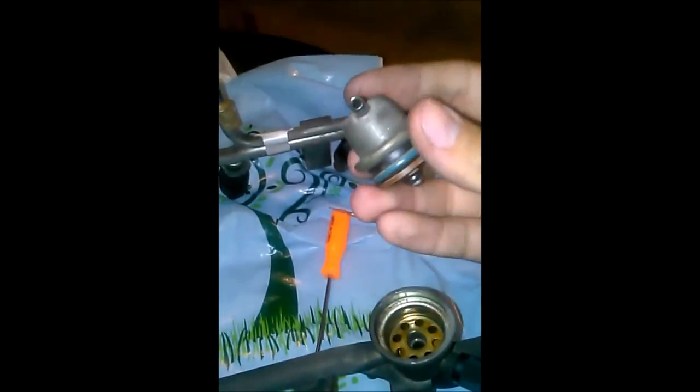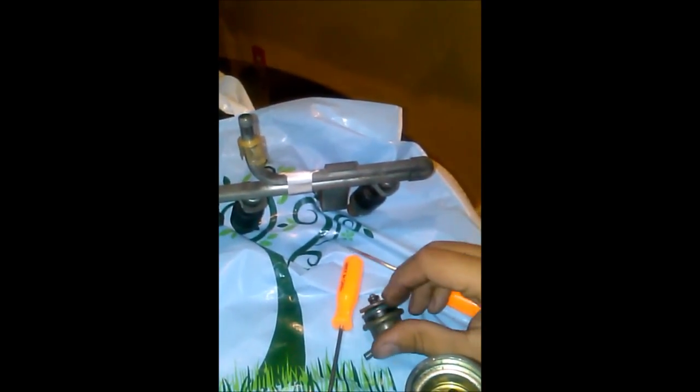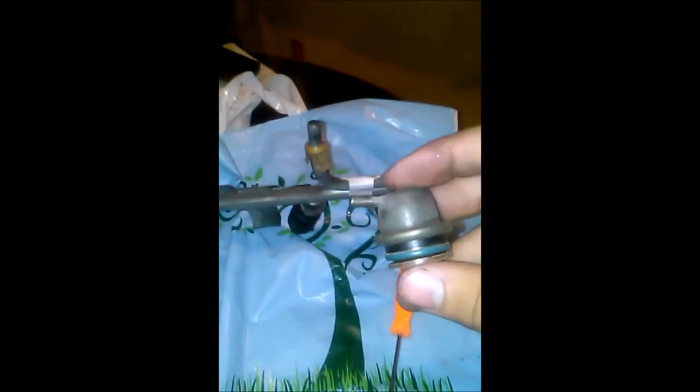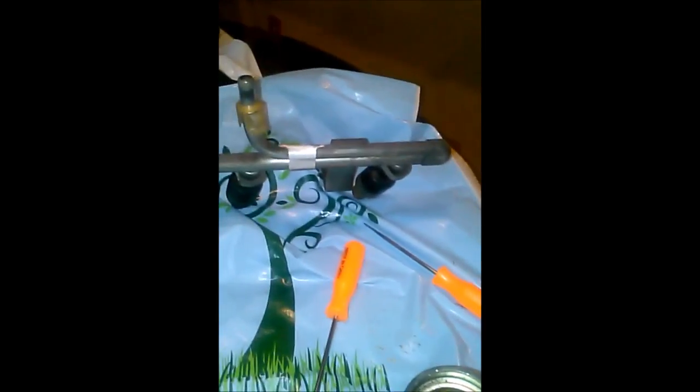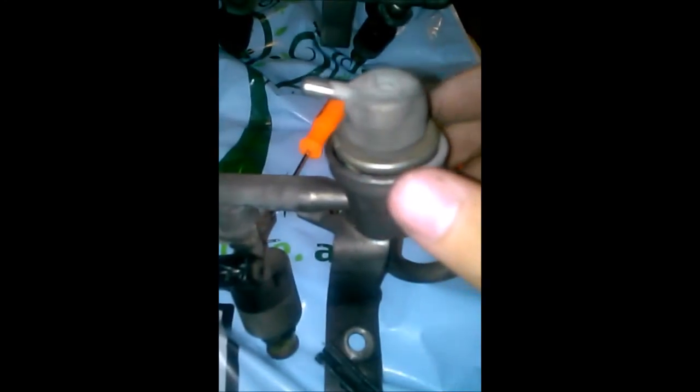Here's the whole assembly for the fuel pressure regulator — this kind of tripped me up. When you buy the fuel pressure regulator for the '97, it's going to look just like this: one whole piece. That confused me because nobody put up a how-to, so I had to figure this all out myself. Basically this whole assembly is going to go right in there, and it's pretty straightforward. Get the new one, put it in like this, make sure it's facing towards this side — just like that — and push it in.